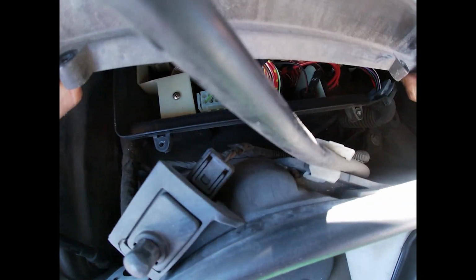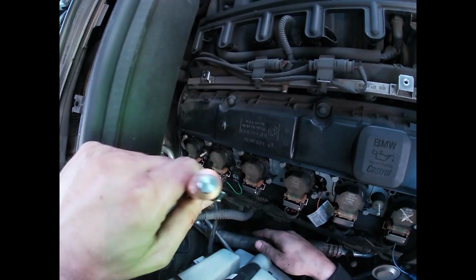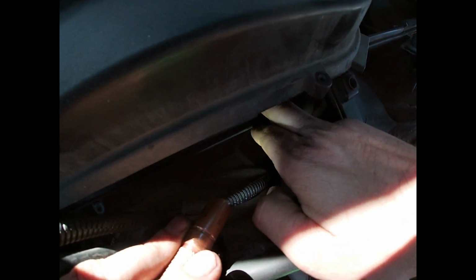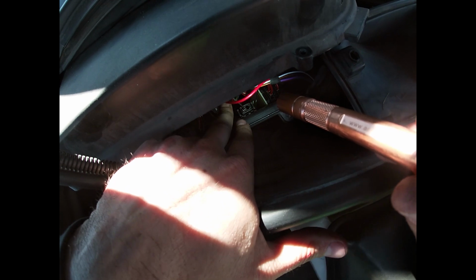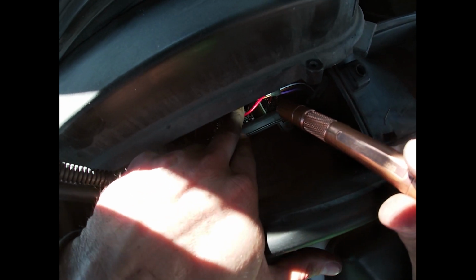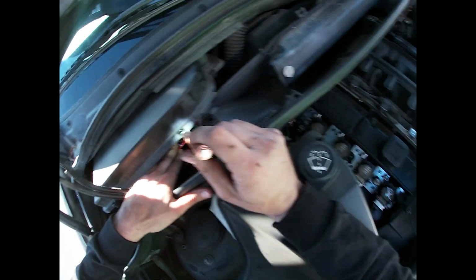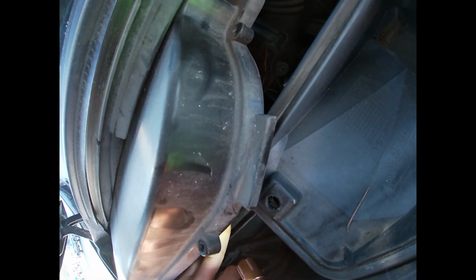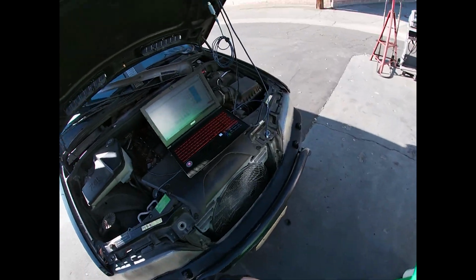That was not the fuse box. So it's not the fuse box, but it's exactly what I need actually, because this whole coil harness goes into here, goes into the firewall, and that loom goes up in here, and then this. So if I had to guess, it's going to be this thick red wire, because all of the others are black with tracers, and then the brown ground wire. So this is probably going to be the power supply, and then it splices from red. Oh yeah, red white. There it is. The tracer's hiding, but the tracer is there. So that's my power. So I'll be able to current ramp through there.